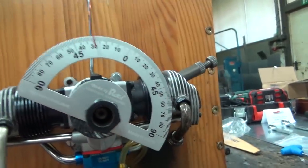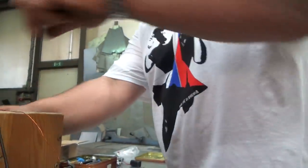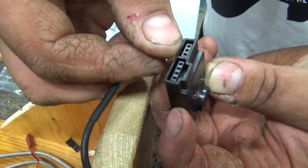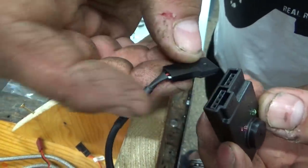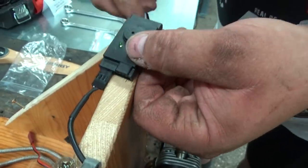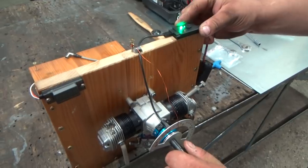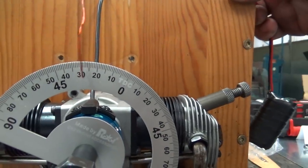like this. Then you will plug in this checker. And when you put this checker in, now this is interesting. Yes, you put it here. This is for single cylinder, for one or two, and this is for more than three cylinders, which is different then. You'll just watch the minus, it's here, like this. You plug in the battery, it's all labeled so we don't mess anything up. And then you move this. See? Now, when it starts to beep, it is set at 30 degrees, you see?